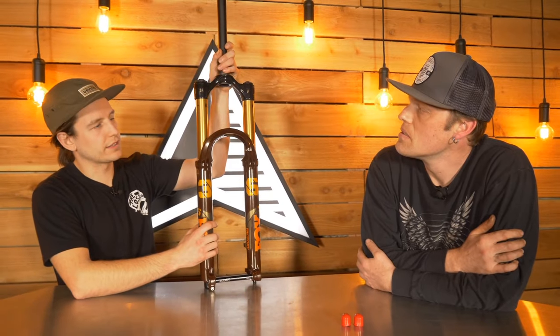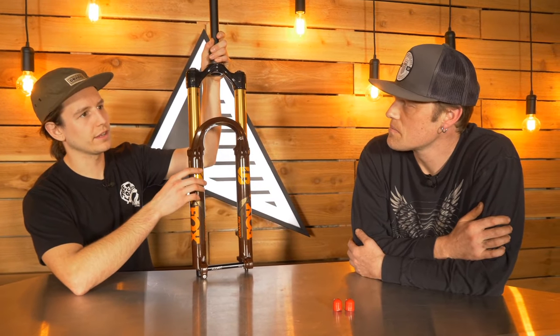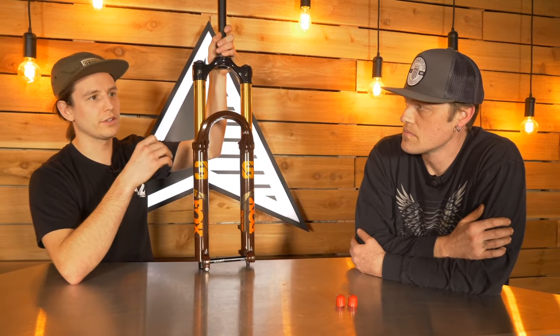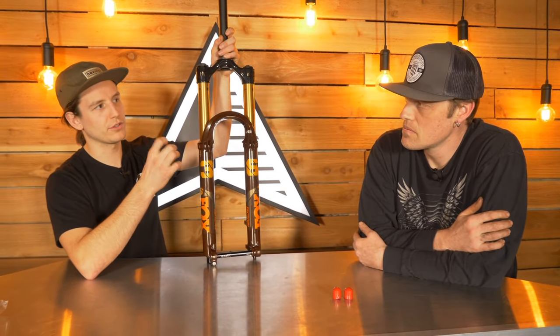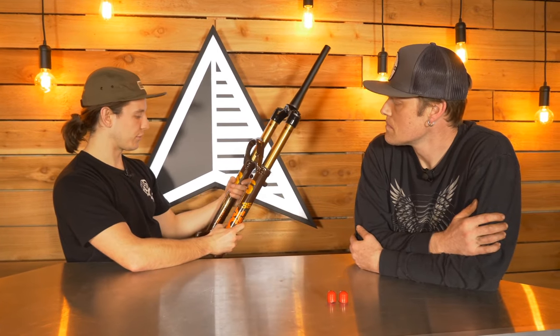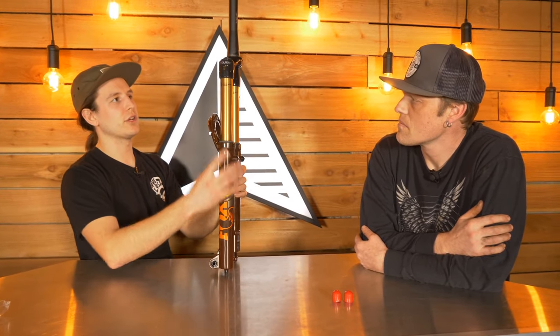Yeah, I think it's supposed to be a little bit better performance, a little bit more consistent, easier to adjust. Apparently, we heard that the clicks are a little bit more noticeable. Sometimes on Fox versus, let's say, a Lyric Ultimate versus the Fox 36 with a Grip 2, I'm a lighter rider. Typically, I can really feel if I add a click of low-speed compression with a Lyric. However, I'm doing about 2 to 3 clicks with the Fox and then maybe fine-tuning backwards, and that's where I could tell a difference. I'm really looking forward to that as a lighter rider, being a little bit more sensitive to the adjustments you're making. Of course, this is the factory, got the Kashima coating, love it or hate it. It looks cool, smooth. Yeah, less stiction.